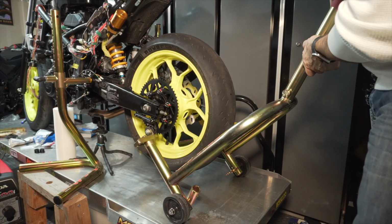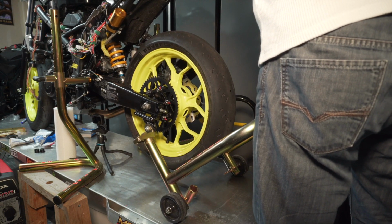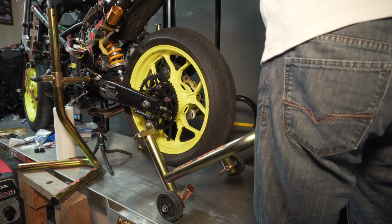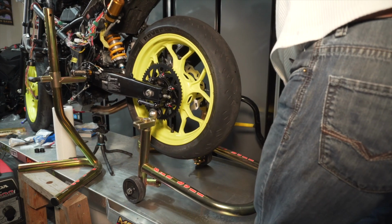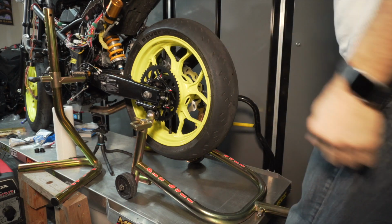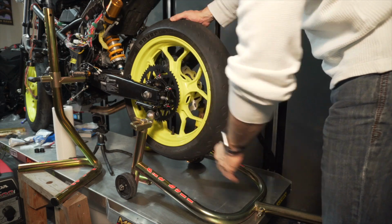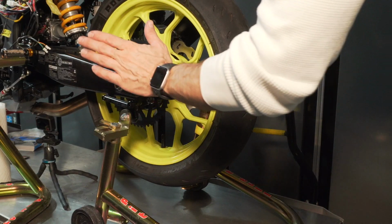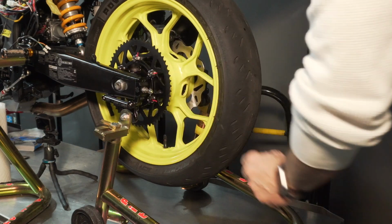So you simply line it up. So now if I push up, I should be able to lift the bike, and I'll do this gently. Make sure that my side stands don't fall down. And here we go. Make sure it's on the table, line up properly. And here you go, guys. This is the process to install the TST Captive Chain Tensioners and the GP lifters. So super easy. It works super well, and now you can see the extra protection that it offers for your swing arm here.